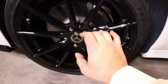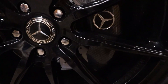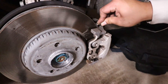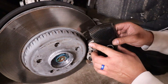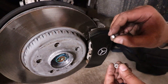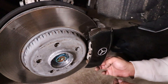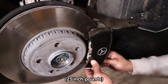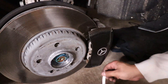I just finished mounting the wheel — there's a nice gap between the spoke and the caliper cover. Now I can focus on the back caliper covers. Same as the front but now I'm going to start first with the brackets, then mount the caliper cover on the bracket, install the two included nuts, torque them down to 25 inch pounds, and then use the feeler gauge to make sure the bracket clears the rotor. And that's it for the install.